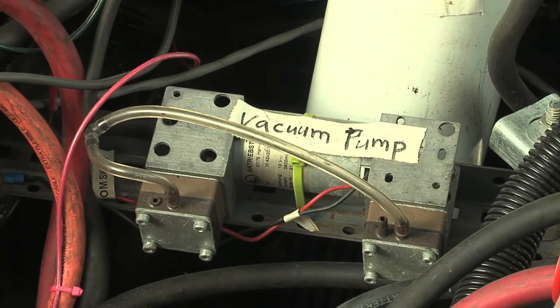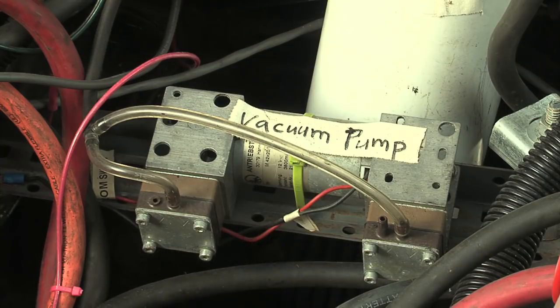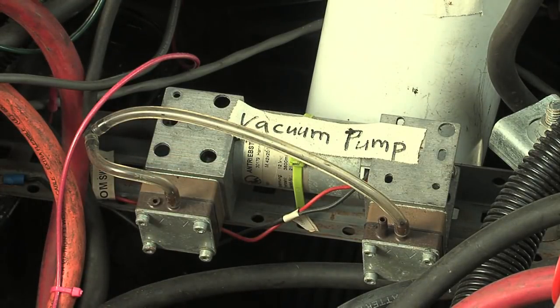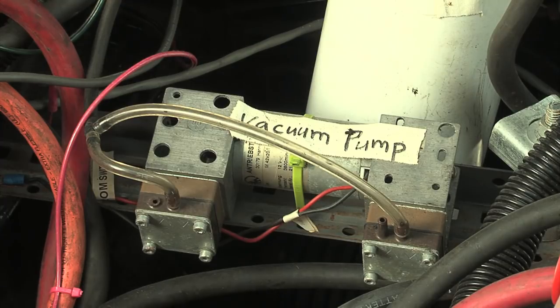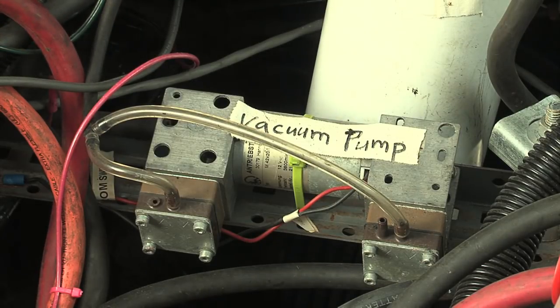You're going to need some sort of vacuum pump. This one is a 12-volt pump a friend gave me. You could get one from a mail-order surplus supplier or a junkyard — all it has to do is suck. You want it to be 12 volts so it can run off your existing accessory battery. It has a red and a black wire: red goes to positive power, black to any ground on the car. This is a double-ended pump — it sucks on both ends — connected with a bit of aquarium tubing that fit right on there. The line goes up through a one-way valve into the vacuum reservoir.